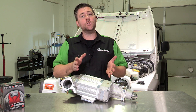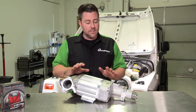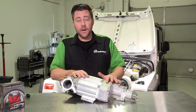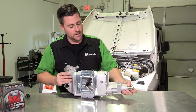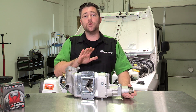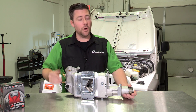Because it is self-contained, it is going to require some maintenance about every 30,000 miles. That's a simple process of removing the supercharger from your motor — there's a fill plug and a dipstick on the top and a drain bolt on the bottom. They also recommend that every time you service the supercharger, you also replace your serpentine belt and your spark plugs.